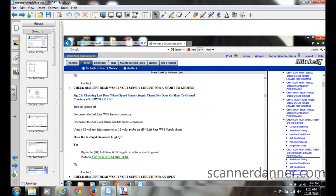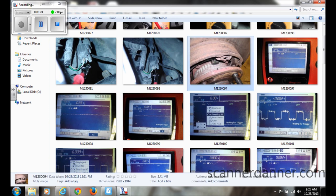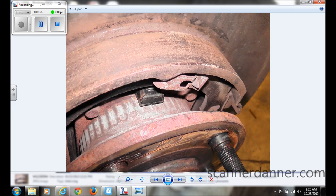We're going to talk about a 2008 Jeep Commander ABS wheel speed sensor problem we had in here the other day. Here's a picture of the hub — this is the left rear we're looking at. Typical speed sensor reluctor inside this hub assembly; pretty small teeth on this one. That was something we noticed right away.